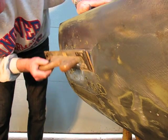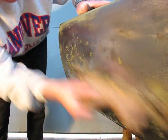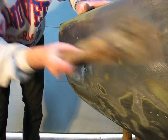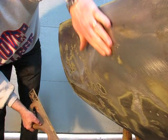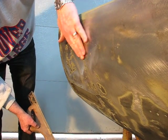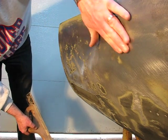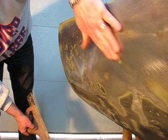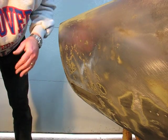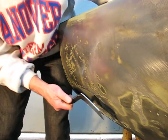Okay, let's see what we got here. Now this is a spot I did earlier and you can see that's kind of high now. I'll go ahead and use my shrinking disc on that one — that ought to bring it back down. But I still got a low spot down here, and you can always tell when they're aligned because the slapping spoon starts bouncing around.